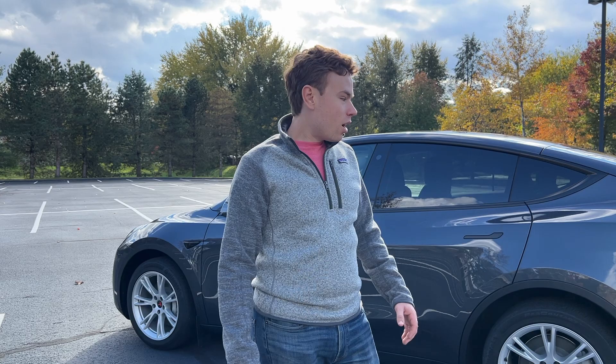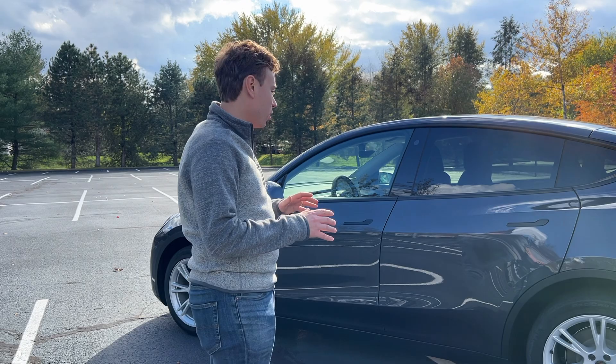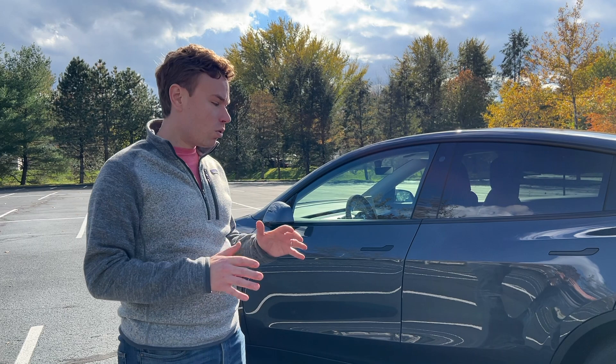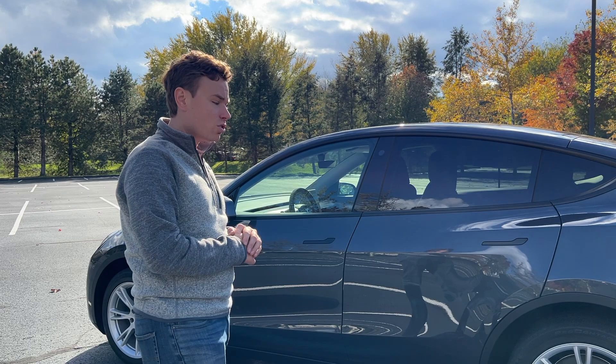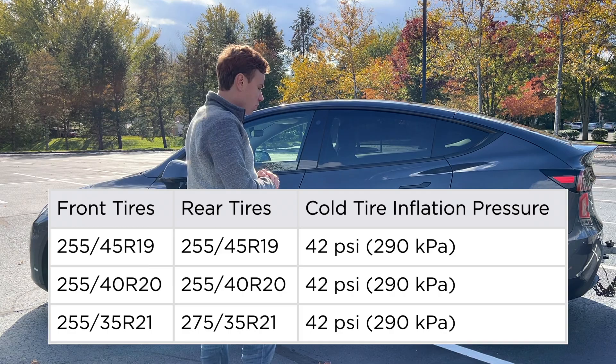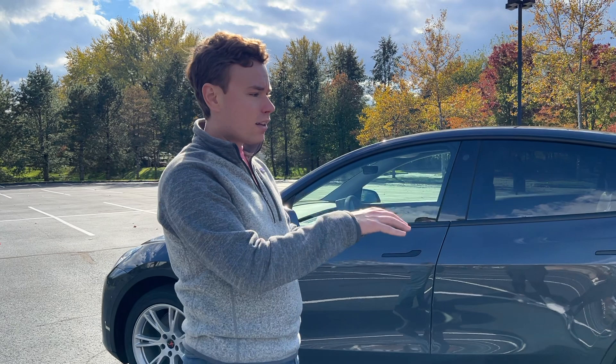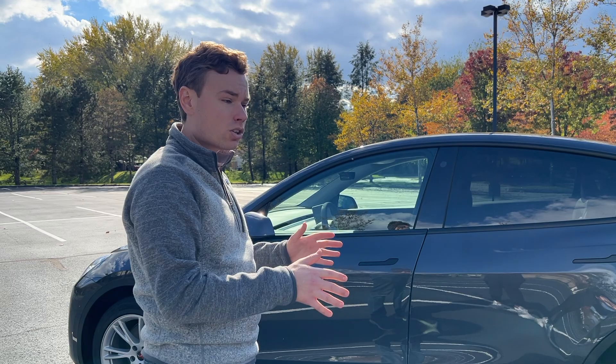Before you go towing, there are some safety things on pages 76 and 77 of the Tesla Model Y owner's manual you want to note. First, make sure you have proper tire pressure — Tesla actually recommends increasing tire pressure to 42 PSI when towing. Second, look at the car and make sure it's perfectly level. You don't want it weighed down awkwardly because that will affect the dynamics when towing. Trailer sway or an uncontrollable trailer is dangerous, so the car and trailer together should look level.